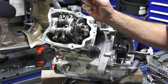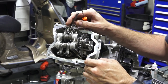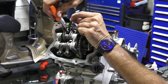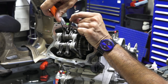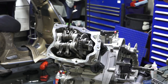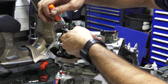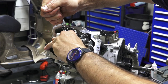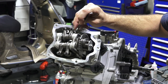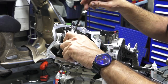So I'm going to put the 4-thou feeler in there. And it almost feels perfect. It's actually just dragging ever so slightly. So loosen the lock adjuster. And right where it stops, I'm not even putting any resistance on it. So get the wrench back on. There are special tools that do this whole motion in one shot, but to show how you do it with the regular old tools here. That one's a little on the tight side. See how it really drags through there?